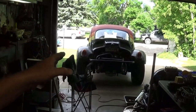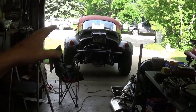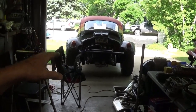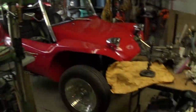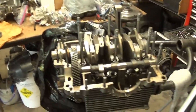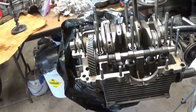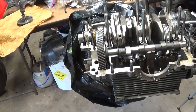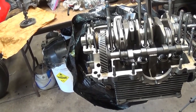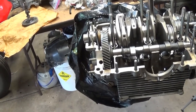The other thing I like, if you want to, on the 2-liter, you can run the stock valve heads and heater boxes with no issues. I screwed up a set of heads by running 40 by 35 valves and using the stock heater boxes. You should change up to aftermarket heater boxes if you think that heat is something that you have to have and can't live without.